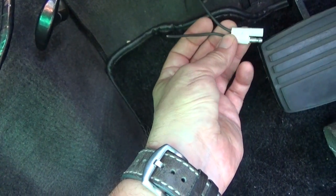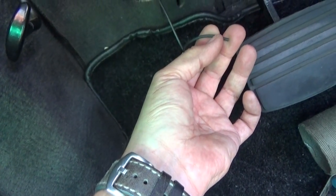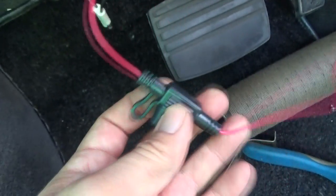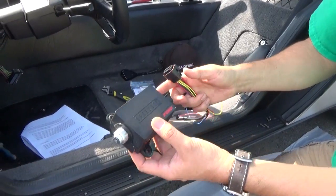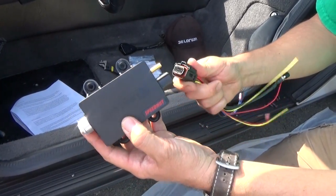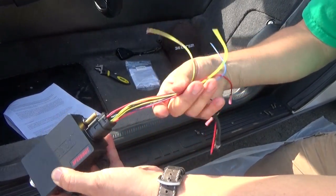What we're going to do is cut into the white lambda harness connector and splice this to the red power wire going to the new unit. We just spliced the fused power wire to the lambda harness here, the male connector. The next step is to connect the Speedbox wiring harness to the Speedbox — you just plug it in like this. Good to go.